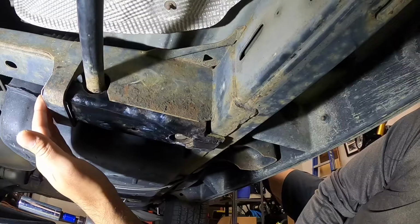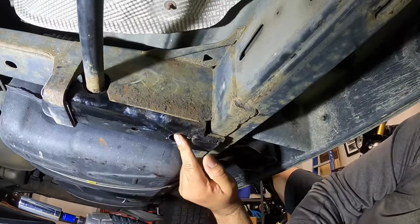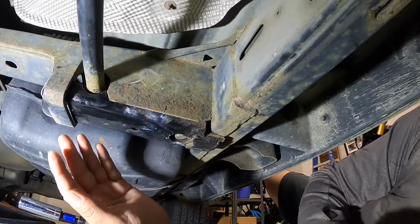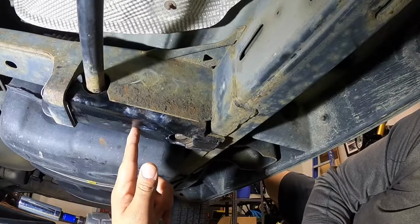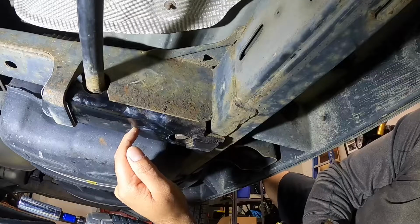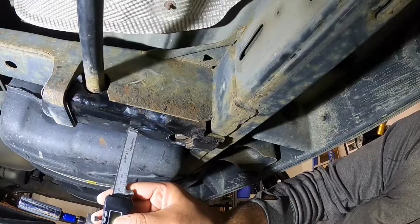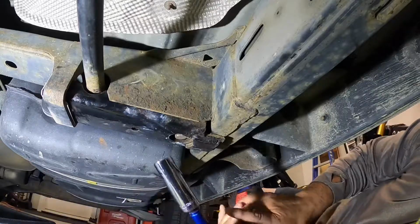Okay guys, once the plate's sitting in its spot, it's just a matter of driving the bolt in as far as you want to just adjust it according to your own requirement. If you like the stiffened front end, or if you want to have it slightly lifted with the torsion, just adjust accordingly. Or if you liked it the way it was before you started, then just measure it before the job starts and then go from there. Like mine was 1.5 inches, but I might actually make it a little bit stiffer to see if I like it better that way.